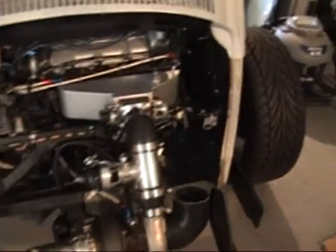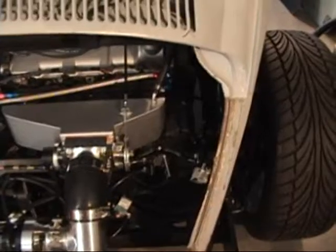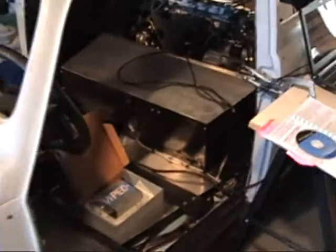Everything's ready. I just put a quick tensioner tightness on the alternator belt down there just a minute ago. I'm setting up my computer here — I just made myself this little desk. First thing I'm going to do is go ahead and calibrate the O2 sensor just to make sure I can do that. Then I'll be hooking up to the Vipec computer which goes right here. I'm going to program the O2 sensor and then do the main computer.